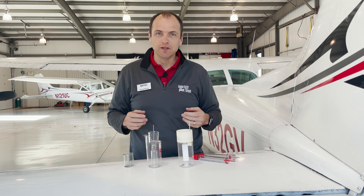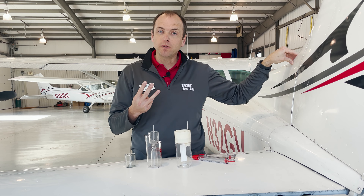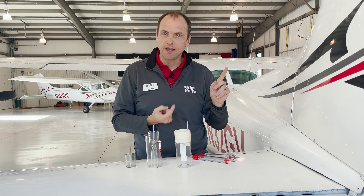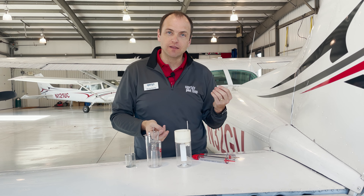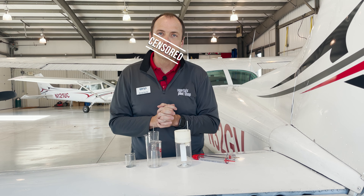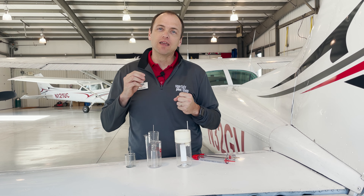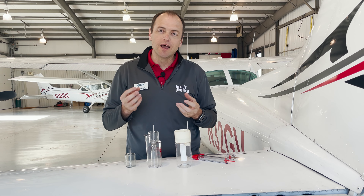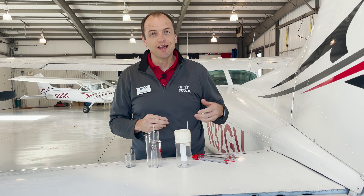You'll notice there are a lot of different capacities for these fuel testers — the GATS jar can hold a whole lot more fuel than the fuel sampler cup. You'll also notice there are different numbers of sumps on different airplanes. This older Cessna from the 70s has three sumps: one under each wing and then one underneath the engine. Newer Cessnas, built after 1997, have 13 sumps — five on each wing and then three underneath the engine. We wanted to know why, so we posed that question in the early 2000s, and a Cessna aircraft engineer gave a really good answer. He said, 'Well, there's one for every lawsuit.' The idea is the engineers at Cessna found the areas in the aircraft most likely to collect contaminants and water, and they put sumps there. Hence why we have 13 sumps on the newer Cessna aircraft and only three on the older ones.